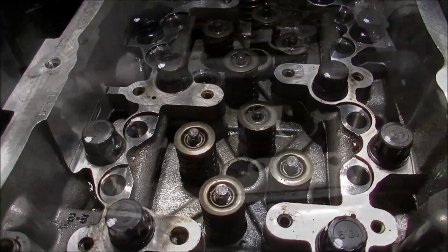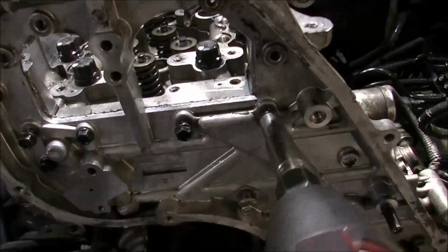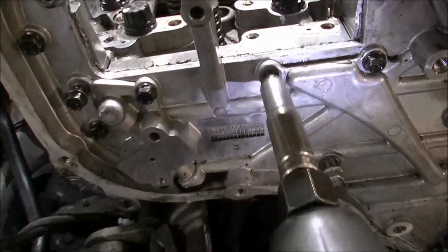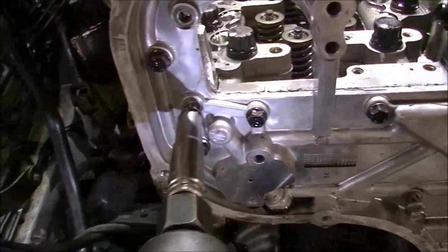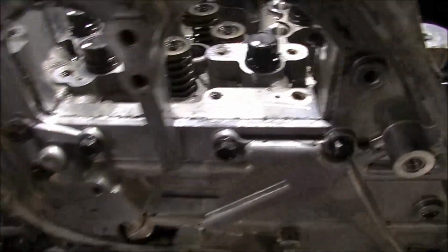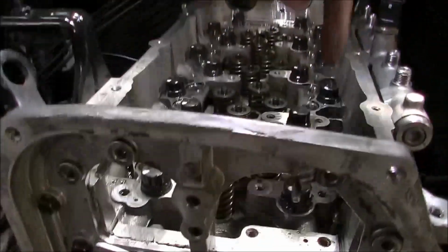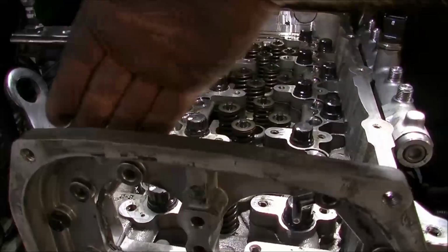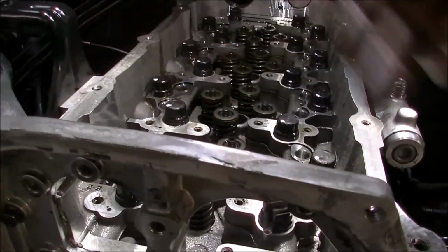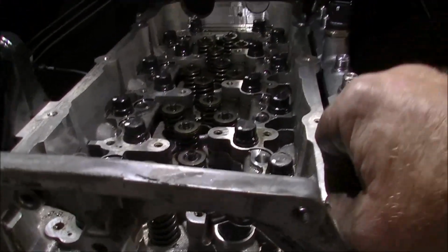Time to whack the rockers in. And just quietly, you can't mess about with it too much because we've got silicone on the back of this, so we need to make sure that this stuff goes in before it all goes off. We've got to put the cam in now. The lifter's in, then slide the cam and its carrier in there. And then there's another section that goes across the front here and houses it all in.